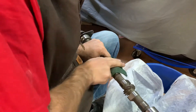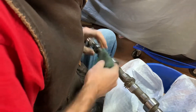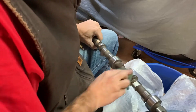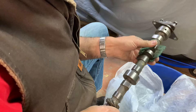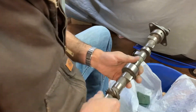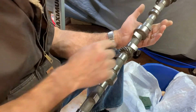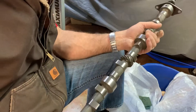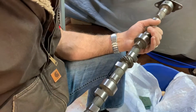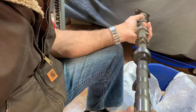Maybe while we have the camshaft out here, we can talk about a few interesting things on a camshaft — for the beginners who are learning; if you've done this, just fast forward. This gear in the middle is driving your oil pump on one side as the camshaft spins, and on the other side it's driving your distributor. This is the rear of the camshaft.